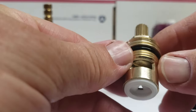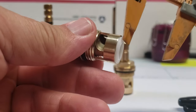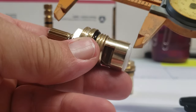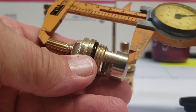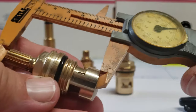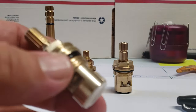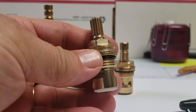That's the easy way to find that sixteen spline. The next thing is top-to-bottom length measurement. A lot of people will measure from the gasket on the bottom, but the gasket is not that important for measurement. What we do is go by the metal edge — from metal top to metal top. This one actually measures out just a little over two inches, about two point zero seven.